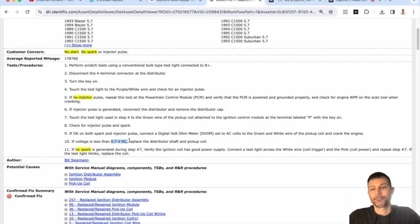Connected to the ground is a fusible link on the positive side. Yes, sir. There's a fusible link on the power circuit. That is correct. Okay. And that is connected. It's just like all part of the connection on the positive. Well, I believe it's connected to the fuse block, which is on the firewall, like I mentioned. But don't bother checking it until we've actually confirmed that there's no power at the distributor. We're getting ahead of ourselves.